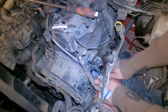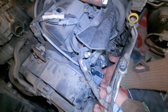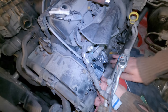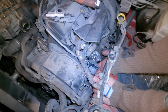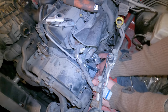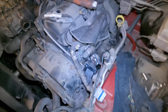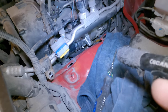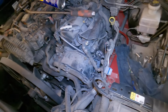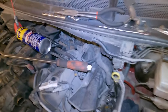Yeah, so basically the forward bolt, the front lower bolt, needs to be in. You put it in the EGR valve or mounting it to the cooler because of the turbo pipe, or was it? Yeah, intercooler, intercooler turbo pipe. So those two are in. Then we can just enter the last one, and then we have the clamp in the rear. On the rear. Yeah. Top used bolt. The best looking used bolt.